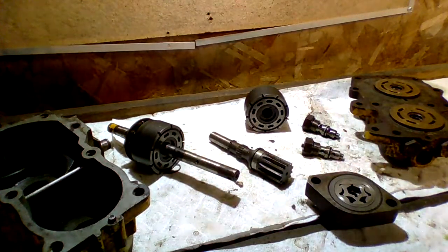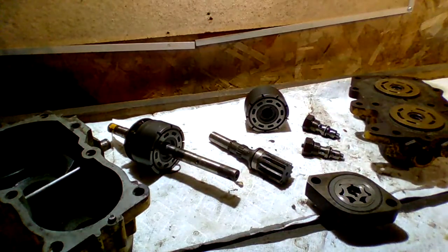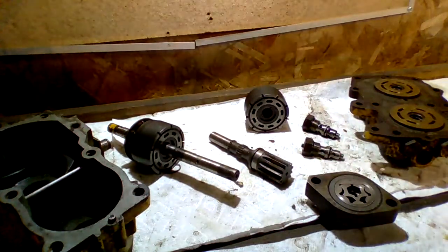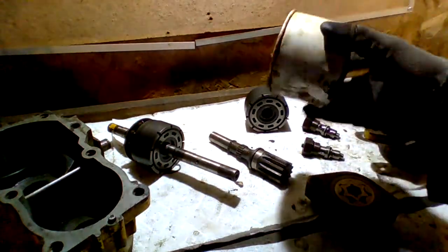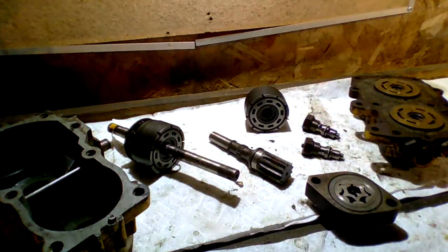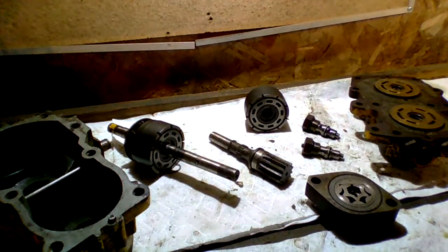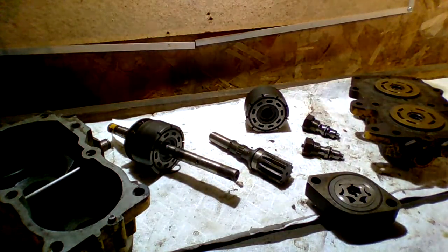Something really important you're going to want to note: if you're rebuilding one of these, you want to make sure you are absolutely as clean as you possibly can be. You don't want dirt in these, because these are very precise machine mechanisms and they don't like dirt in them. And of course, make sure your filter doesn't look like this — this obviously still shows 30 years' worth of sitting outside on it. That's why they have a filter: to keep all gunk out, because you do not want gunk getting inside this transmission.